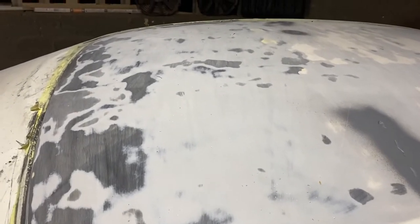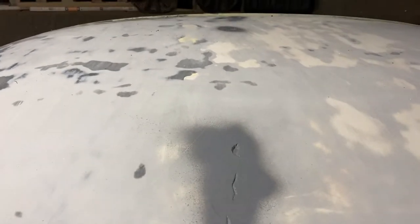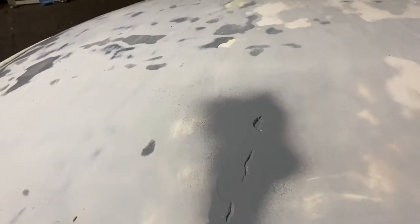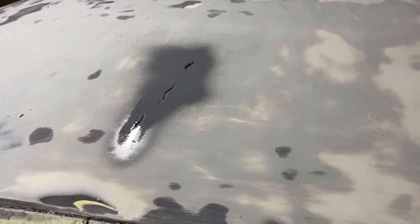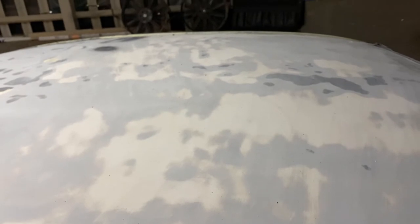We got all the rubbish paint off of it. As you can see, the bodywork of the previous person that did the work is also starting to crack up. So we've opened up those cracks and I've sprayed them so they don't get any moisture in tonight. There's also one on that side. So tomorrow it's basically fill those up, flat sand, primer, sand down and spray. So we will get that done